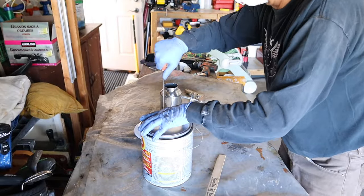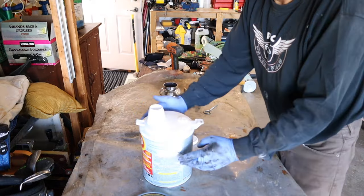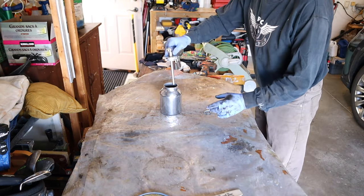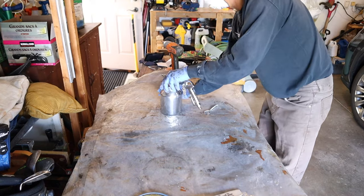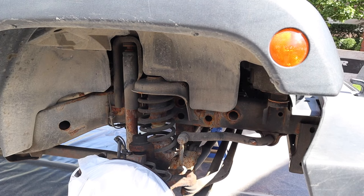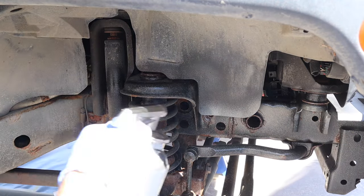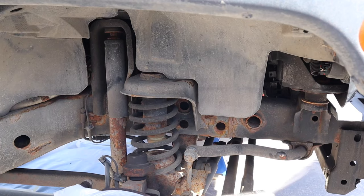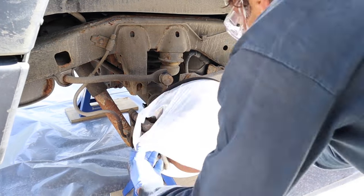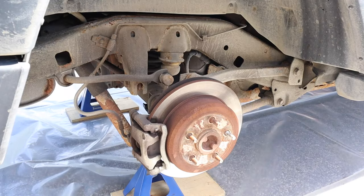For starters, it's advisable that you keep the can of the product in a hot bucket of water so that it has time to soften up. Then you can just open the can and stir up the product so it's nice and smooth. I used a paint can pouring lid to allow me to pour the product nice and neatly into the spray can. Depending on the temperature of the product, your spray gun and your compressor, you would set it at 75 to maybe 100 psi, whatever works for your equipment, and begin to protect your rotors from getting any product on them — you can cover them with a plastic bag. Now here we are in the front passenger side wheel well, and it's time to just start spraying the frame and all the other metal components. I tried to keep the spray gun about a foot away from whatever I'm spraying. Here's a look at before and here's a look at after. And now we've moved to the rear passenger wheel well — cover the rotor and start spraying. Before and after.